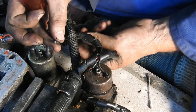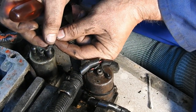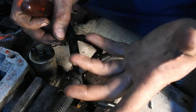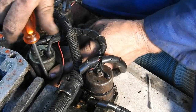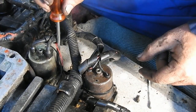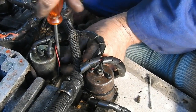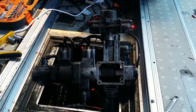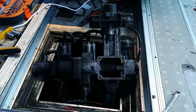On each of these solenoids I've put a little red LED. I've put a resistor and a diode in there. If you do this, you need to put the diode on the back of the LED so the back-EMF from the solenoid doesn't blow the LED. I've done that so I can map the transmission solenoid sequence — if the computer ever gives me trouble in the future, I can build a new computer for it.